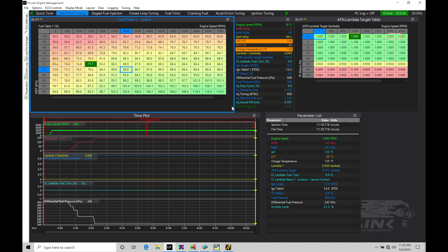As we're spraying the water meth solution into our engine, we're going to have a two-part effect. One, we're going to be raising our effective octane because methanol is going to have a much higher octane compared to something like 91 or 93 octane. So when we're spraying water meth on 91 or 93, it might be like we're actually running 100 or 110 octane. By running a higher octane fuel, we can increase our spark timing, which allows us to make more power. On a turbo engine, we might even be able to increase boost pressure.